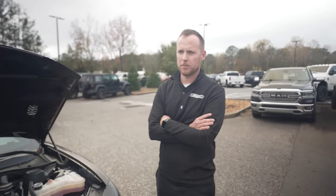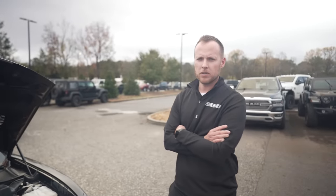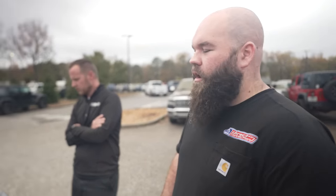If you are on E85, you should pick up 80 to 100 wheel horsepower at the top of your 93 number. So realistically, on the E85 on the Ghoul package, mid 900s on a 10-bar dyno, maybe a little lower to the wheel on a Dynojet's old software.